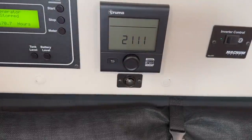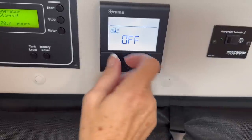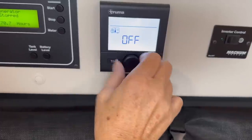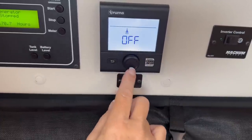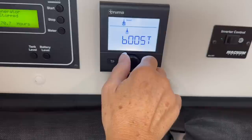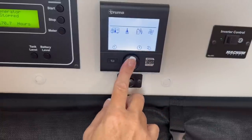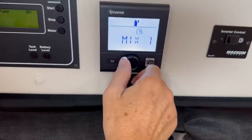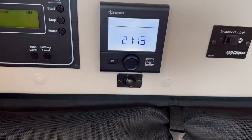Next to that is the control system for the heater and the hot water tank. Push the center button to see the icons — whichever icon is blinking, that is what you're controlling. Set the heater to whatever temperature you want, or to off, and then press the center button again. To set the hot water tank, make sure the icon is blinking and set it to whichever setting you prefer — the water will take about 15 minutes to get warm. Press the center button again when done. The next setting lets you choose full electric, full gas, or a mixture of both for your heater and hot water tank. For example, if you're hooked up to shore power, you would want to put it on all electric so you're not wasting your propane. Press the back button to exit the screen.